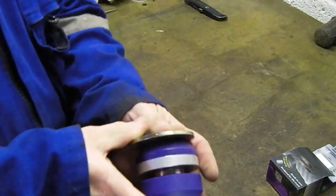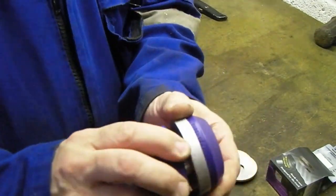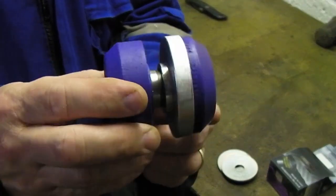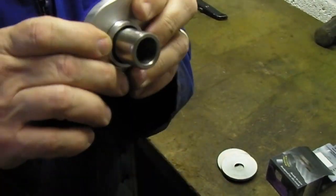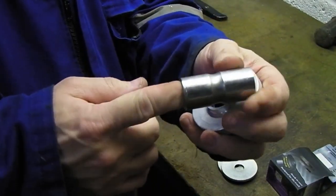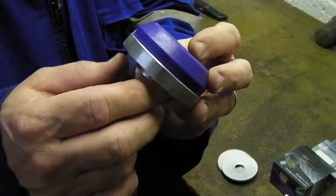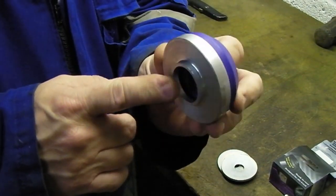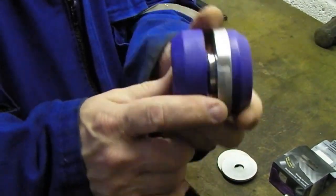Let's show you what we've got to put on - here are the replacement bushes. We've got the big washers at either end, the polyurethane bits, and the inner bush - or sleeve - that's the bit that sits on the rod. There's a little aluminium top hat thing which I've already pressed in. I just basically stood on it and it went on. So that's all the bits; I'll show you the old bits on the bus.